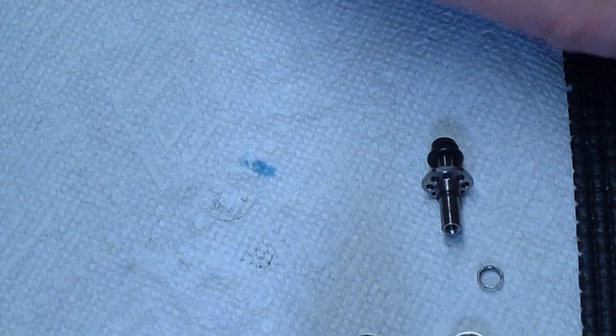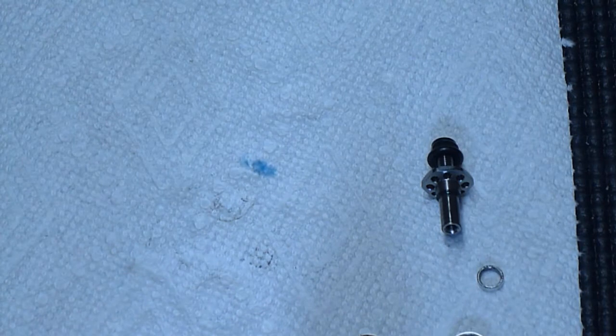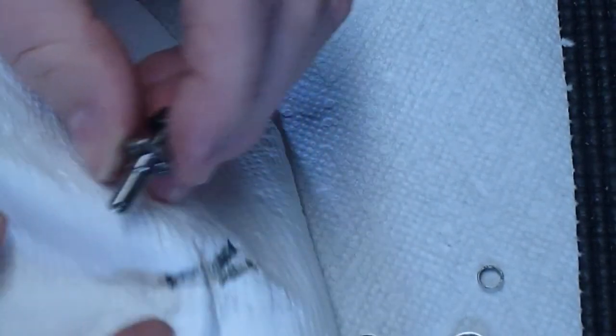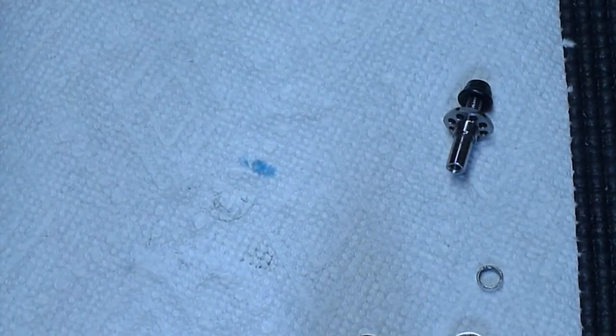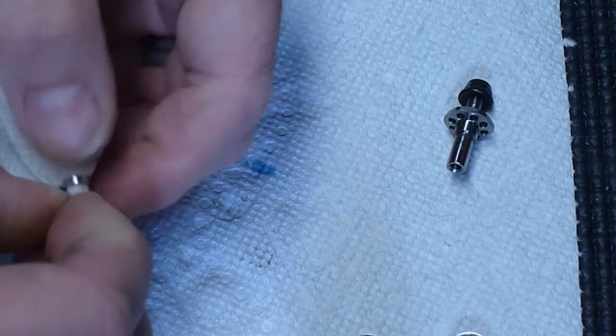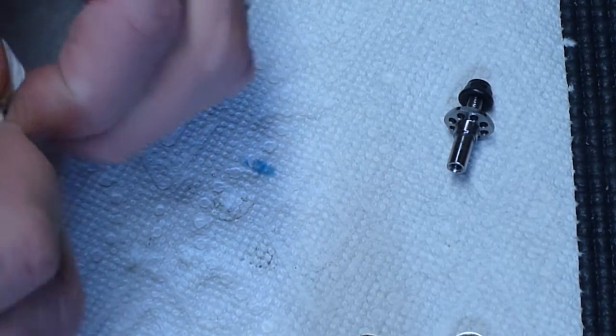This is going to dry and cause it — when I put my axle back in — to not move around a whole bunch. That'll make my turning a lot tighter. Now the next thing I've done is I've cleaned my axle off. That's what it looked like. Cleaned all my titanium axle — my Exotec titanium axle. Next I'm going to clean my crush tube. I always, when I take stuff apart, clean it up really good. That's like the main thing — whether I'm rebuilding shocks or rebuilding a diff, you always want to make sure everything is cleaned up really nice and neat.